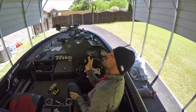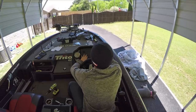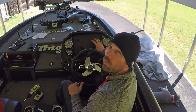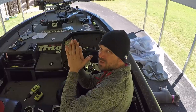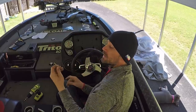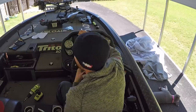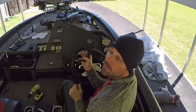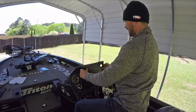We have the back plate — make sure it's right side up. This is where our wires are going to go through, this is where our gauges go through. We're going to pop that thing on there, and you'll notice we need to expand these holes with a hole saw so we can get our wires through. Before that, we need to mark these four corners — that's where our brackets are going to sandwich to create the pressure strength that holds this entire bracket setup. I just grab a small drill bit, fit it through the holes to mark them, then lift it off and drill.